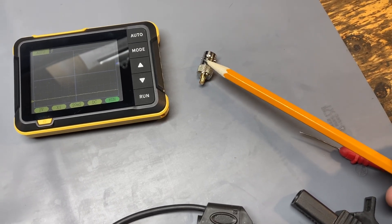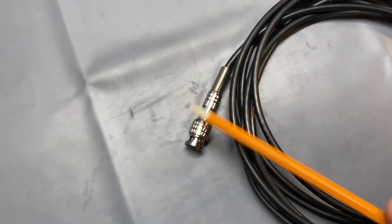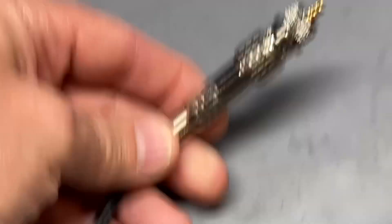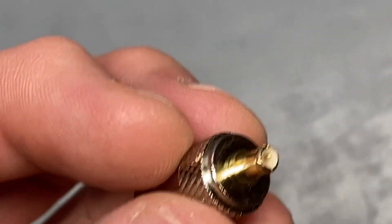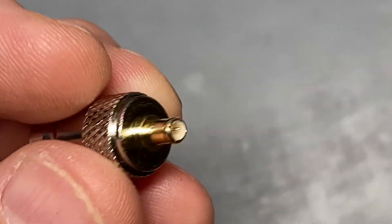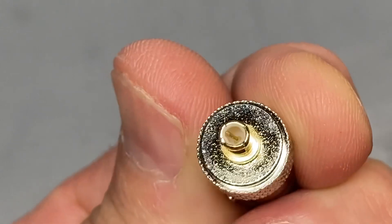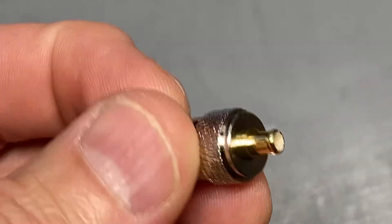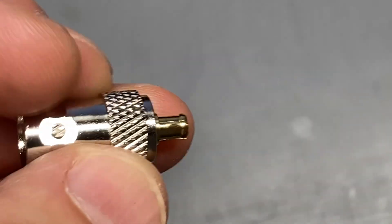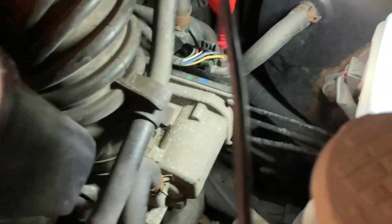You'll need the MCX adapter — mini or micro coax to standard coax on the leads. Be careful with these little adapters: it's easy to drop the lead on the floor, and this brass is soft enough that I've crushed one into a serious oval shape. I managed to damage the inner pin — it's all bent over — and if you connect that to the scope you might damage the coupling. Just watch these; they're delicate.